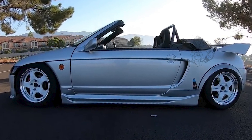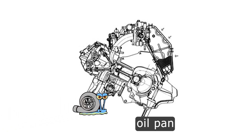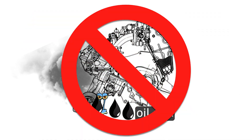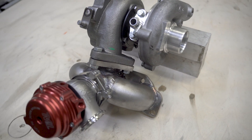Unlike traditionally mounted engines, the E07A is a 3-cylinder mounted on a slant. I mounted the turbo essentially parallel to the oil pan, so the oil backed up into the center housing and made a smoky, oily mess. I tried to remedy the situation with a sump pump, but the proper way to fix it is to mount the turbo correctly. So in this video, I'll show you how I made a new turbo manifold for the Honda Beat.